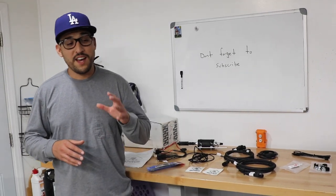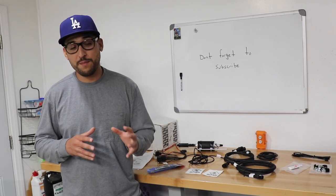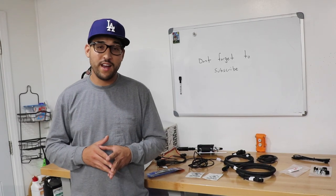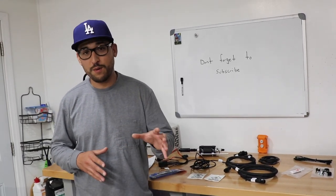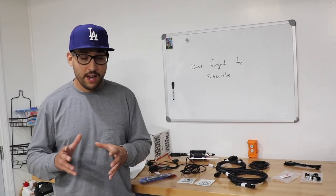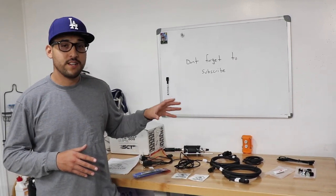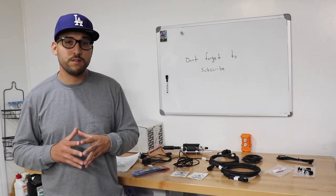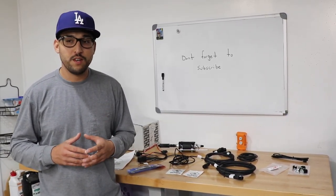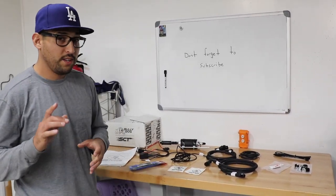As you saw on the last episode, we got Boogeyman up and running. It's ready to rumble. So we went ahead and scheduled our appointment over at KP Fab and Tune, and this car has an appointment to get dynoed over the weekend. Before we get this car on the dyno, we want to make sure it survives a dyno session. So we went ahead and ordered an SMG auxiliary fuel system kit. This fuel system kit is going to supply the added demand of fuel when running in boost applications. And it does that by doing this exactly.